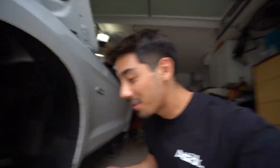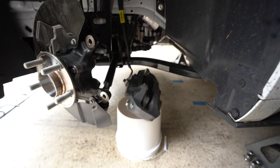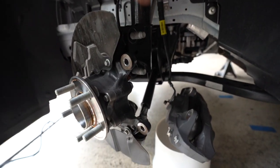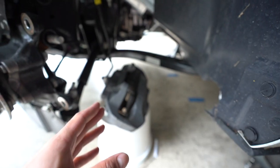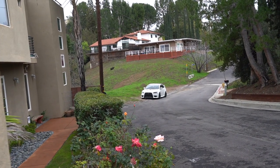This has actually been a lot more work than I originally anticipated, so I haven't been filming it well. Every bolt on this American car is huge — I'm using a 24mm on an impact, which I've never done on any of my Hondas or Japanese cars. After a lot of wrestling, I finally got the knuckle nuts off, the strut, calipers, and rotors off — all just to swap some springs. Springs always take more time to install than even a coilover setup.